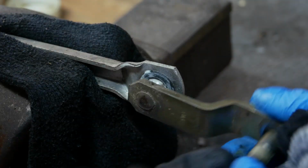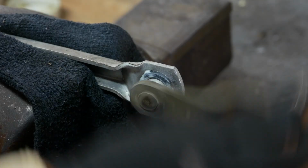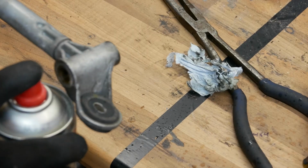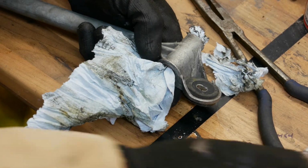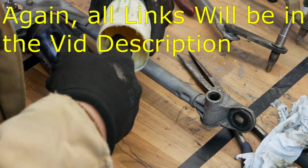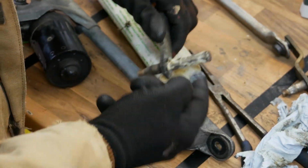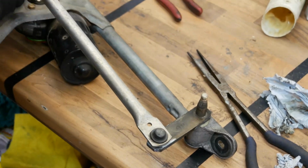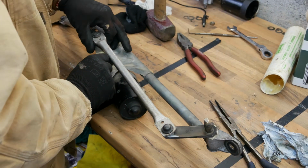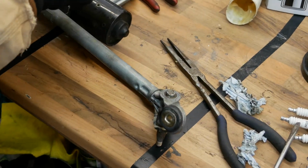Now you can go ahead and reassemble the joints again just using a pair of grips and gently squeezing it back together. For any joints where there isn't any rubber present, you can use WD-40 as a cleaning agent and then just use a normal general purpose grease during the reassembly. So now it's just a case of cleaning up all the joints, re-greasing them appropriately, reassembling it and making sure all the fasteners are back in place that holds it together.